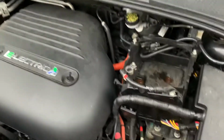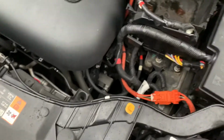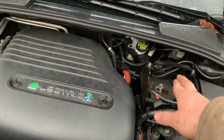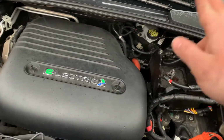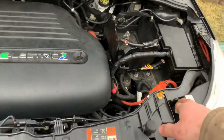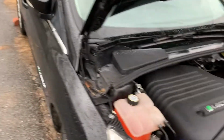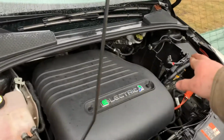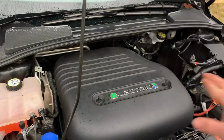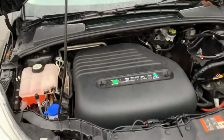carefully and slowly. For anybody not familiar with electric vehicles, orange lines are high voltage. This in its current state is not hooked up to a battery, so it cannot power on. That will not run the doors or anything like that. But those orange high voltage lines still have power, as long as you have power in your high voltage batteries in the back. The only thing your battery limits is it will not flip on the relays to run power out of your high voltage to run the motors. So you got a little bit of a fail-safe in there, but it is not foolproof.